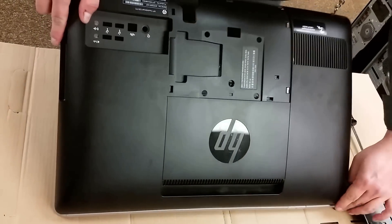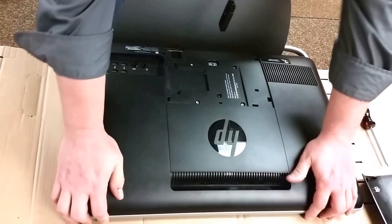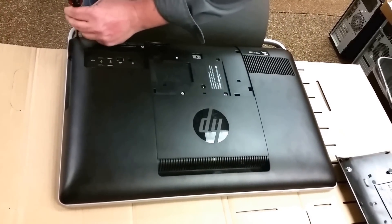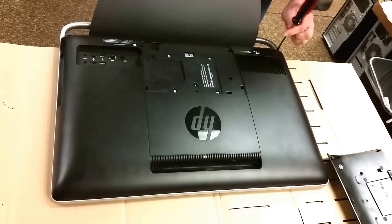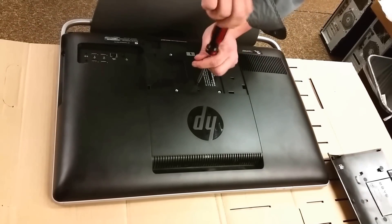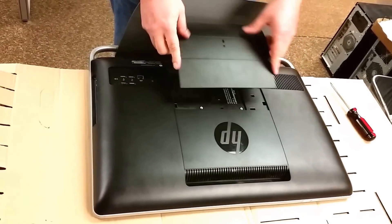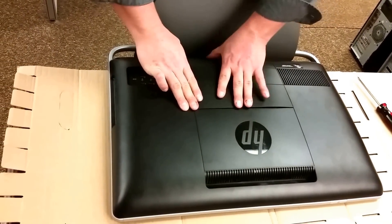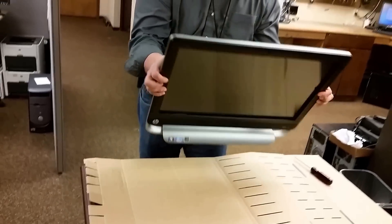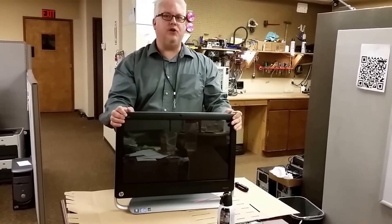Missed the front side. We'll just tighten the three screws back down. And the cover goes on lastly — it slips in from the left side and snaps back into place, making sure it's all flush. And now we are back in business with our HP TouchSmart 520 all-in-one PC. Simple hard drive and RAM replacement.